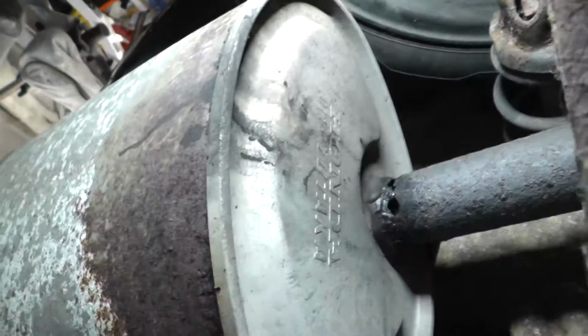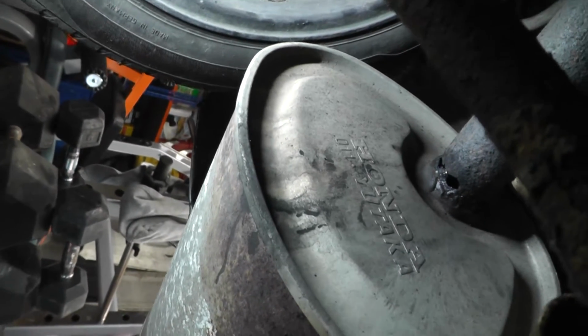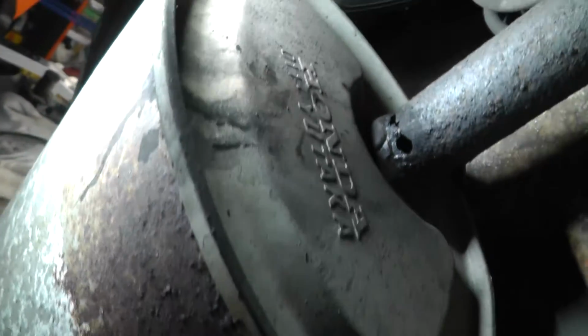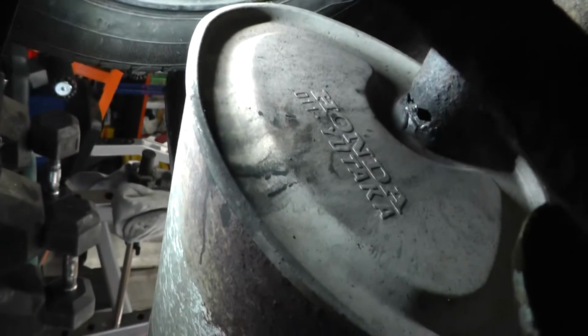Oh no, it's not. I've just seen something. The back box is completely rotten. And it's the original one. It's the Honda one. So that is our problem. And I'm going to need to do something about it. I mean, that's completely rotten the whole way through. You can see. So it needs a new back box to get the MOT, but I can't believe that is the original Honda back box.